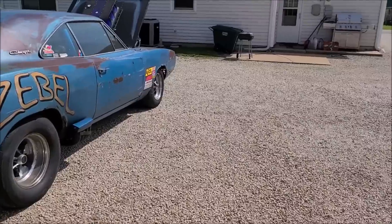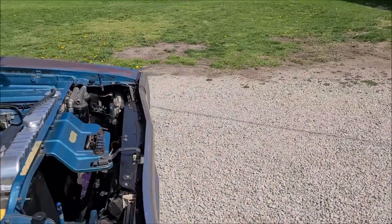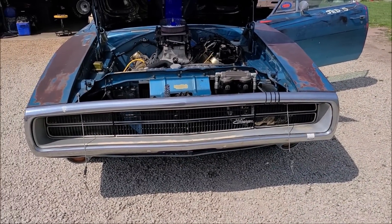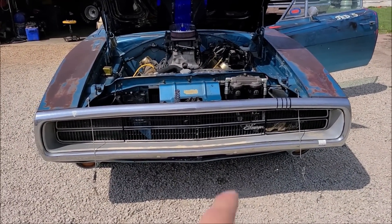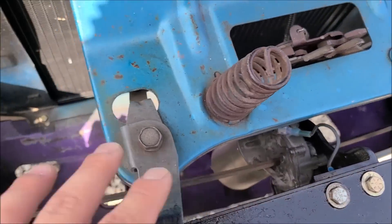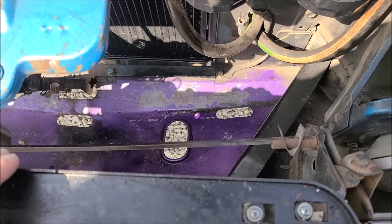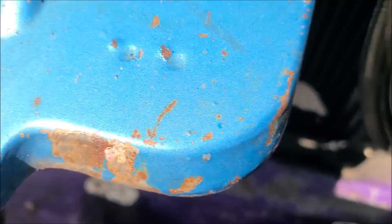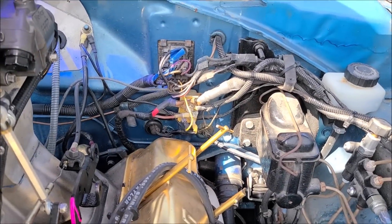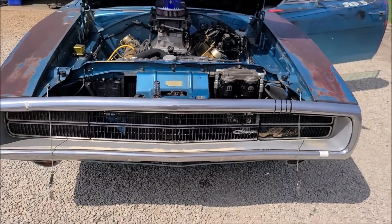On to Jezebel. One part on this car that I've always wanted to get working — and it's never worked — was the hidden headlight mechanism. It just sat in a salvage yard, got parted out for many many years. The original grill was long gone, and I had made this grill out of a couple of parts grills I had. Then I finally got a motor, the bracket, and all the other stuff to get that wired up and working. I made a whole new harness for the hidden headlights — it all snakes up into there and runs right into the factory harness inside the dash, and it works phenomenal. It's so awesome watching those headlights flip up and down.